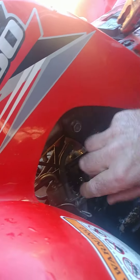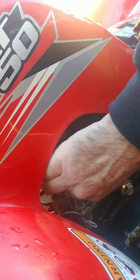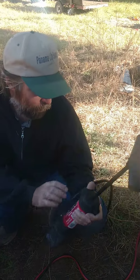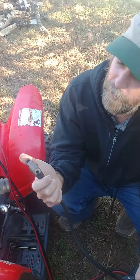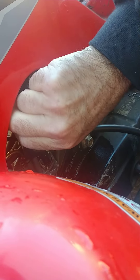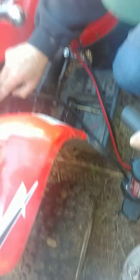It's better than pulling that carburetor off and cleaning it, so might as well try this first. If you look down here, this is the fuel line going into the carburetor. I went ahead and took it off — it goes down where the float is and then up through the jets into the carb and into the motor. I just grabbed one of these simple air masters — you use it for filling up tires, balls, all kinds of stuff. I put it right here under the carburetor, right where the fuel inlet is, and clamped it down.